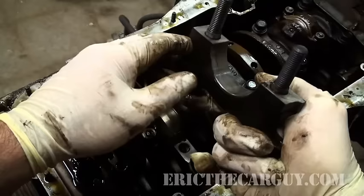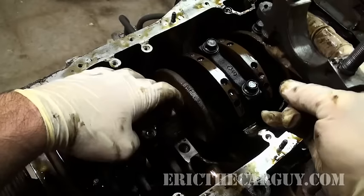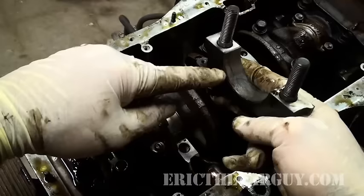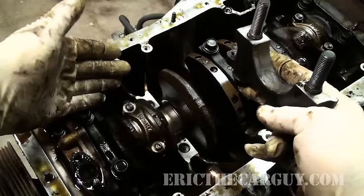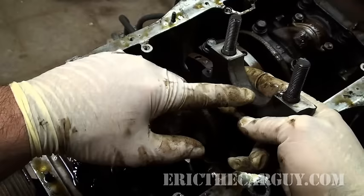As far as oil is concerned inside of your engine, what happens is there's that thin layer of oil that rides between here and the actual journal itself so that the journal can spin. If that leaves for whatever reason, like say your car gets run low on oil, or say you use the incorrect type of oil, that oil will come rushing out of here and these metal parts will start touching each other. Once that happens, that's it, game over. It accelerates the wear on everything.